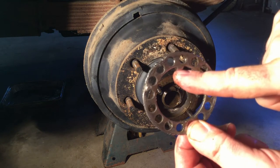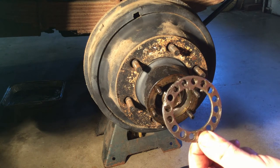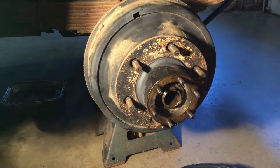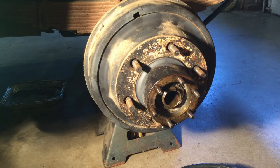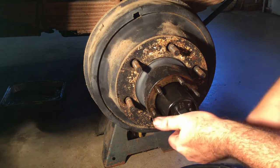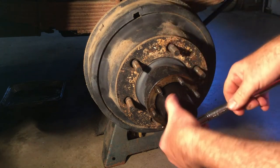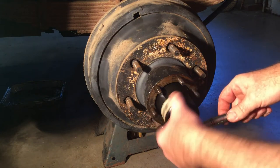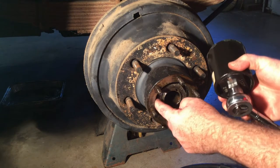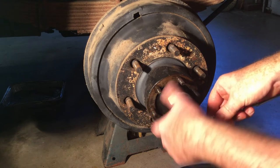That piece goes into the slot on the axle so it doesn't rotate. Once you put this in, the axle lock nuts shouldn't rotate — that's kind of like the lock ring. Then we've got another nut, and I guess I only remember one nut being in there from my days teaching with the Crasher Corporation on trucks in the 70s and 80s, not necessarily two, but that's okay — it's the same socket. This one I'm going to use to adjust my bearing preload. It's a lot easier to use a socket than to tighten and loosen it with a chisel — the $35 eight-sided two and nine-sixteenth axle nut socket is definitely worthwhile.